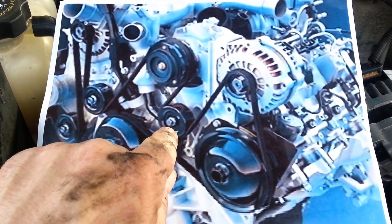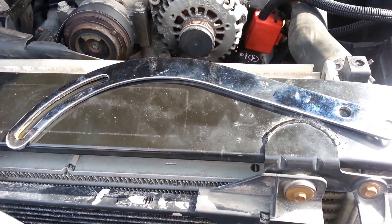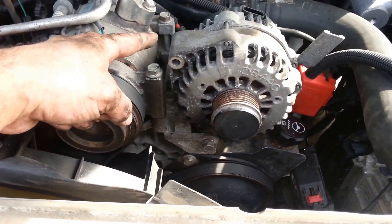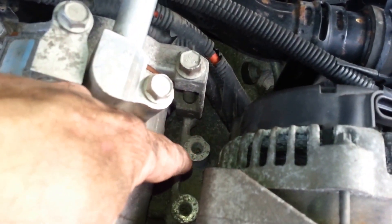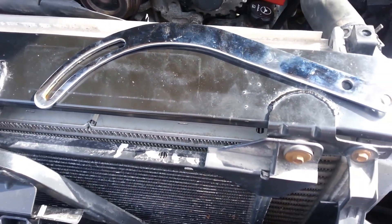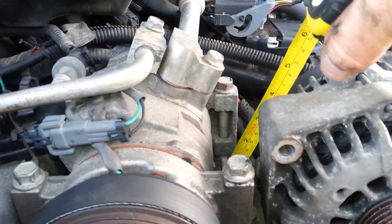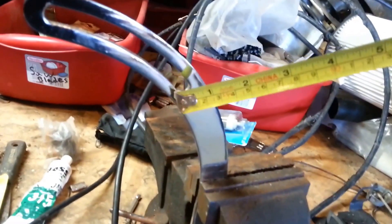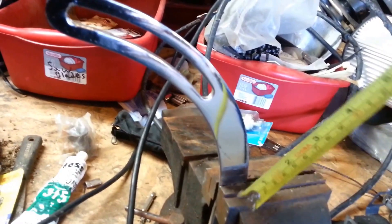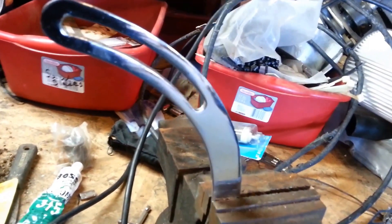We have the new idler pulley here and the new alternator here. I'm going to try to fabricate the support bracket that we need on the back side of the alternator. Using one of these two holes, I'm going to make an L-bracket that comes up and wraps around, using one of your standard Chevy alternator support brackets. The distance we need for the bracket is about three and three-quarter inches to the hole here, and then we're going to bend a tab over at the bottom to recover that space for the extra support on the alternator.